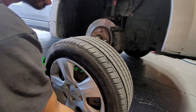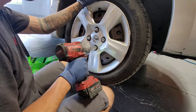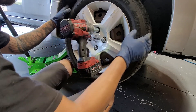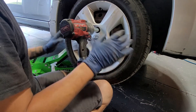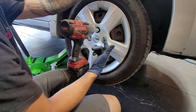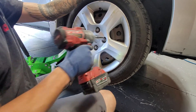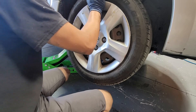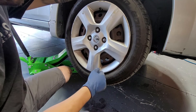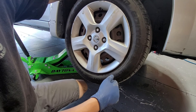Now we're going to go ahead and put on our wheel. We're going to snug in the bottom and the top — this is called centering the wheel — so it aligns and we don't get any wobbles. You're going to tighten the wheel, lower your vehicle, and so forth. If you haven't already, give it a thumbs up, comment down below if you have any questions, and thanks for watching.